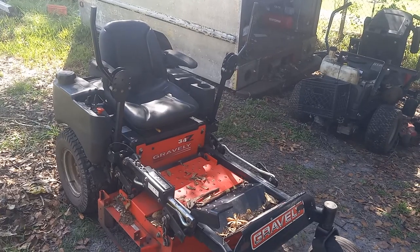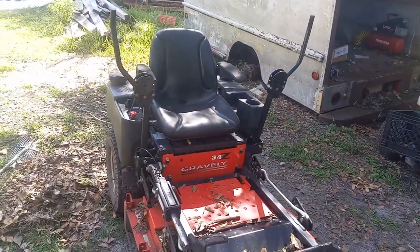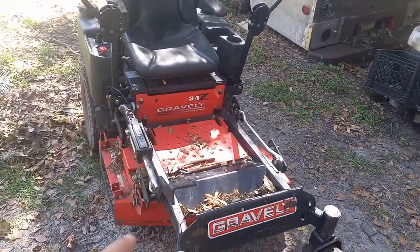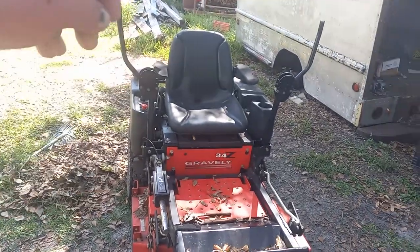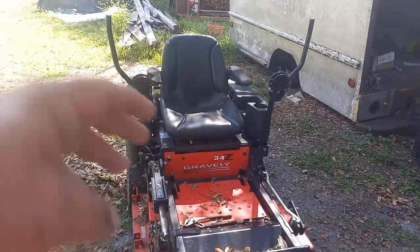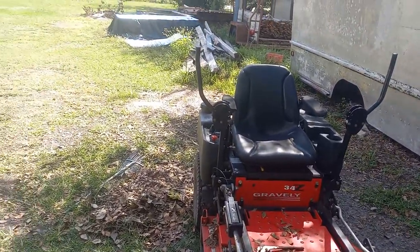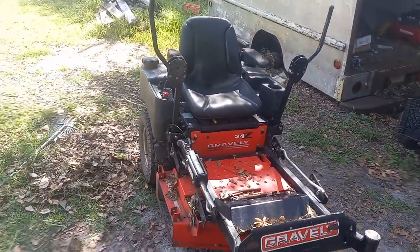While I was waiting for it to be sold, I forgot to hook up the charging system, and I started cutting a few lawns with it a week. The other day the PTO switch stopped working — it was intermittent for a minute. I got through half a lawn, stopped to pick up some debris, the mower shut off and it would not restart. The battery was completely dead.